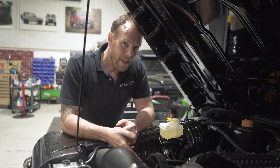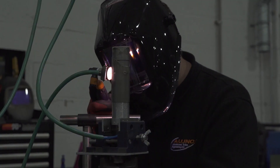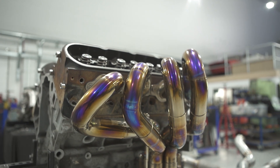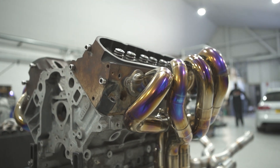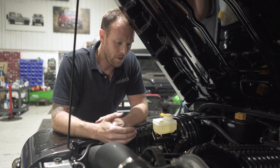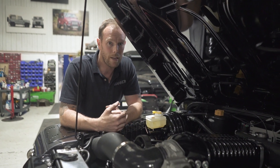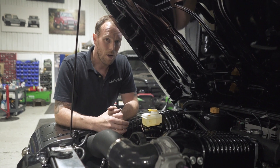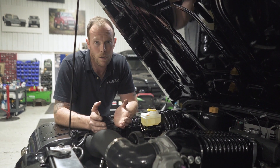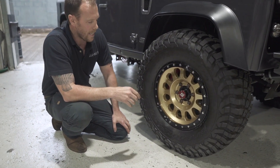The headers are really colourful — these are super special. For those who've seen our previous episodes, we use an exhaust shop, our good friends at Alinox. I approached Leon, a good friend of mine, and asked him to make the best exhaust system possible. He threw a few ideas at me and I said no to stainless — we went all the way with titanium, the ultimate titanium system. We went with two-inch all the way down to the X-pipe, four-into-one on either bank into three-and-a-half inch. So this engine can really breathe — we're ramming the air in with the 2.3-litre supercharger and it needs to escape just as efficiently.